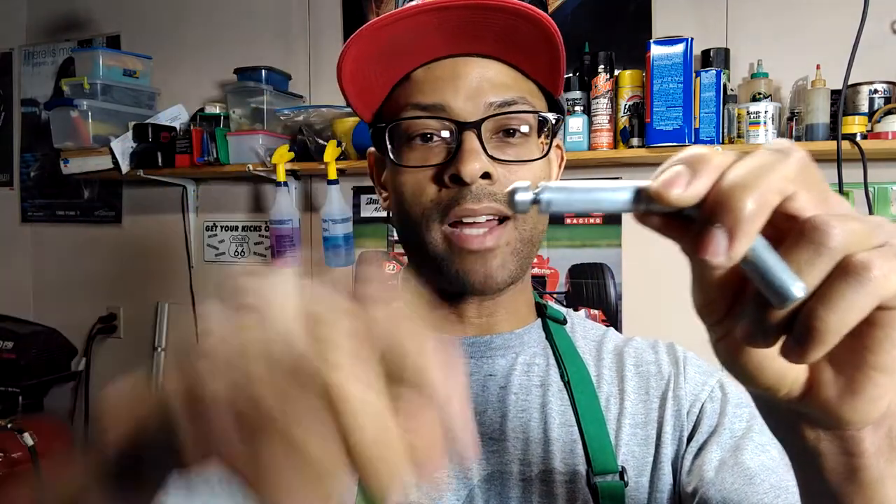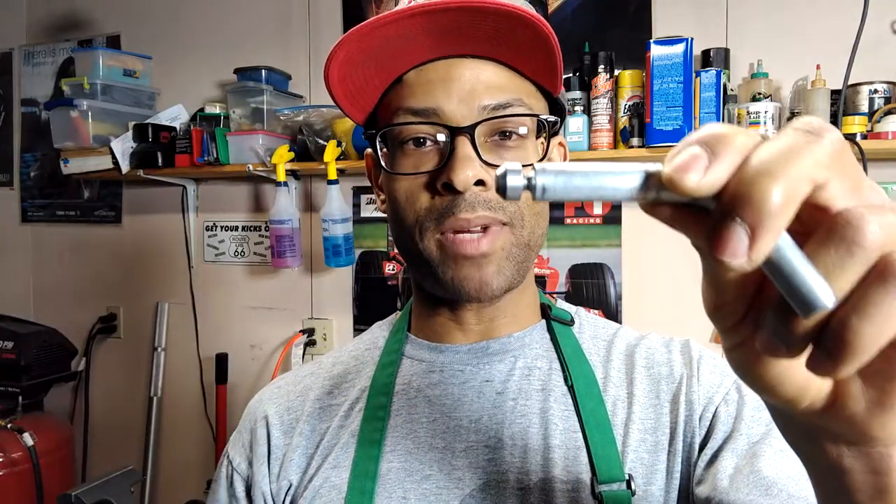Mercedes has a clip that's already on there, sitting in a little channel carved out for it. What can happen is that clip falls off, and if it falls off and that pin gets separated from the transmission, then when you go to select a gear you're just moving the gear select but the transmission is not going into the gear you want.